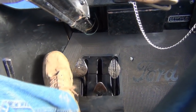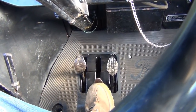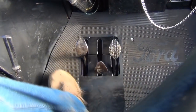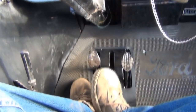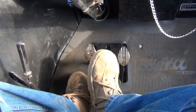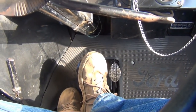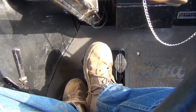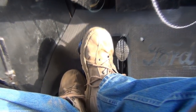For reversing - that's your center pedal - the principle is basically the same as going forwards. Because the pedals are so close together, if you've got big feet you kind of have to put your foot sideways to operate the reverse pedal - I usually do it with my right foot. The principle is the same: set your throttle to an adequate level so you don't stall the car, and then push the reverse pedal firmly as far as it will go. You don't want to allow any of your bands to slip, because you will burn them out a lot quicker than if you're using the correct technique.